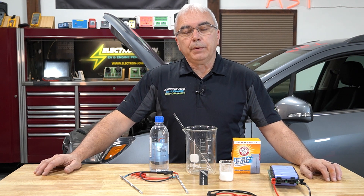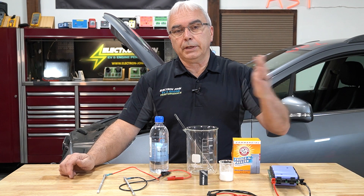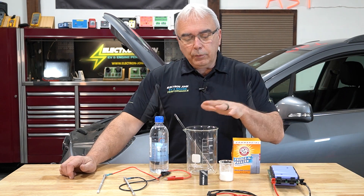As the chemistry starts to fail, the internal impedance inside the battery causes it to become out of balance. You have some lost miles between charges, and eventually that's what ends up killing a battery pack.